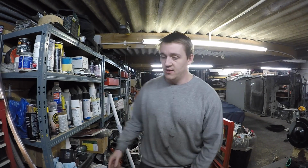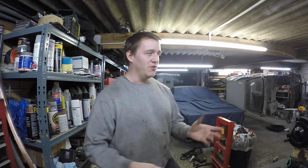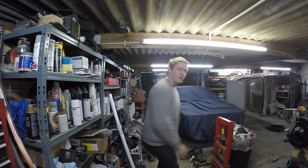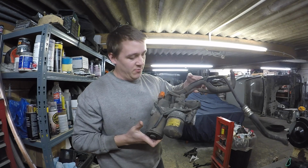I've got a two-way diff that I need to put in the casing, so to do that I think I need to turn it and put engineer's blue on it and check it all. I don't know. I'll get the Nissan manual and then swap that round. So that'll be part of it. And then the other one is the ATTESSA pump. This is where I get a load of transmission fluid all over my bench. Anyway, this is the ATTESSA pump.